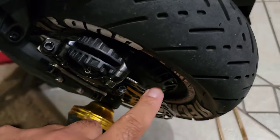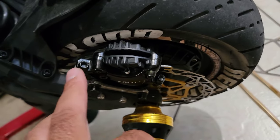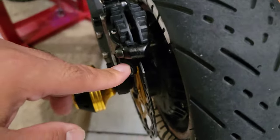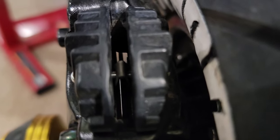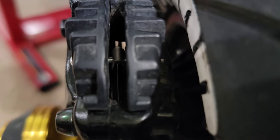Okay guys, we're back — next day. So let me recap. If you're having rotor chatter on your NAMI or any electric scooter, look at your brake caliper and find these two bolts. Don't completely take them out — just loosen them enough so you can move the entire caliper assembly side to side. Then look down in there at the rotor — you want to make sure the rotor is perfectly centered between the brake pads.